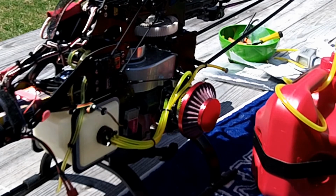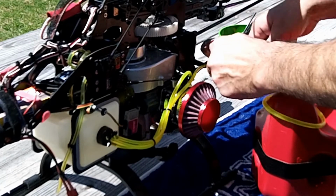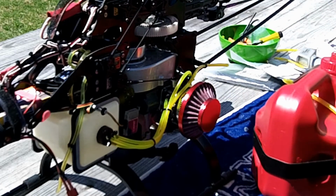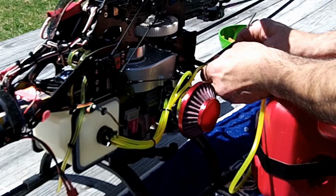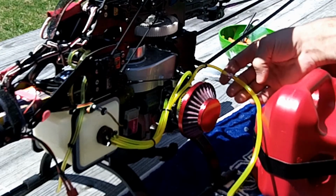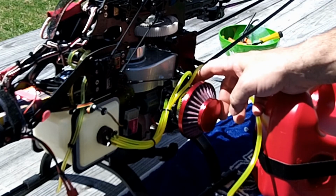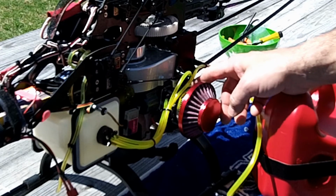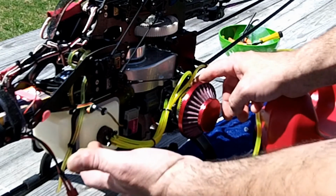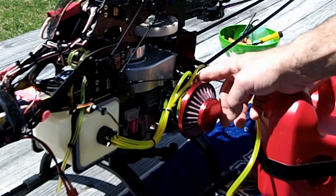Okay guys, so I got my fuel tank here, and I'm going to try to fill the tank. When I went to the lawn and garden place, they said that it doesn't sound like a fuel issue, more of a line issue, like the bulb stopping, rather than a rebuild. I did just put an order in for a brand new carburetor, in a newer model for this type of motor. But they think it's a fuel line problem more or less than rebuilding, because it flies half the tank, which is about 15 minutes to me, because I was just kind of putting around, and all of a sudden it just dies and you can't use the bulb.